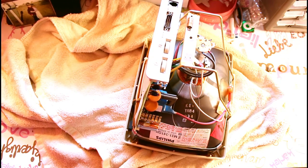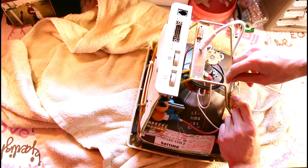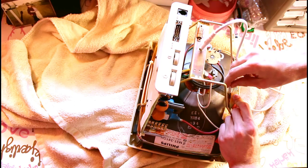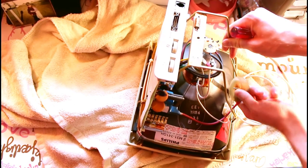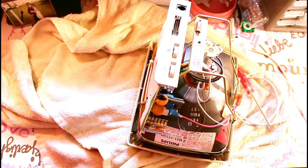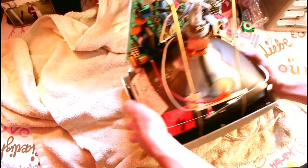I'm now putting down a towel just to make sure I don't scratch up the front bezel or the CRT itself. The next thing I'm going to want to do is discharge the CRT flyback transformer. To do that, I just have a piece of wire that I'm connecting between the anode on the CRT flyback and the ground of the chassis. After taking off this anode suction cup, I'm removing this brace that lines the CRT itself, attaching it to the front bezel.